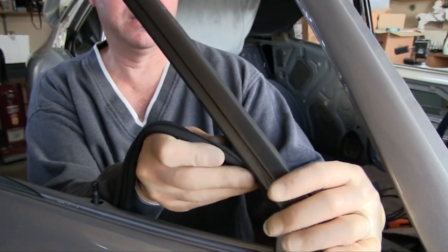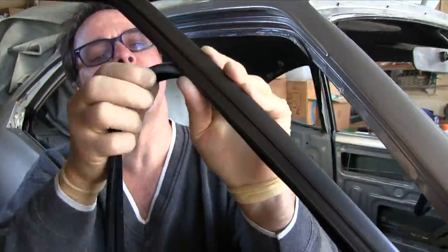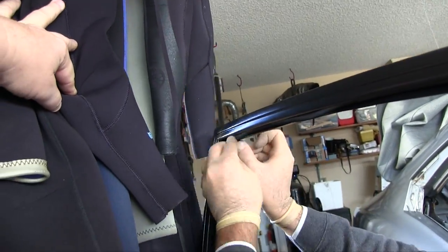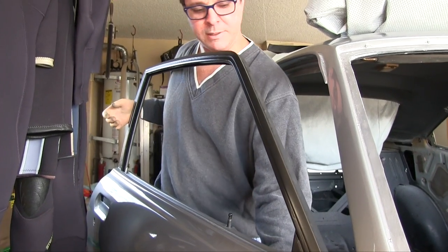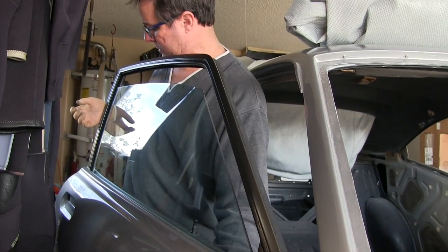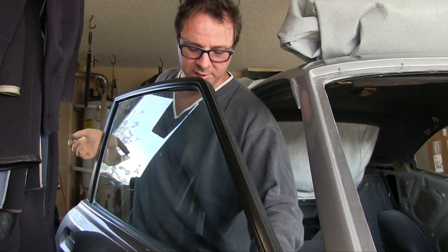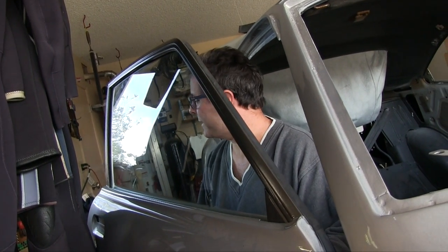The fat piece goes up and around the window frame. The narrow channel will fit, but I suspect you may have more wind noise with that piece. I'm going with the fat stuff because I have it. Let's get a look at this side and how it rolls — it comes up nice for halfway and then gets a little tough. The other side rolled better than my green car ever rolled. This side's a little tighter — it could be because I haven't restored the regulator inside the door. Did not pull it out, but I might end up doing that.